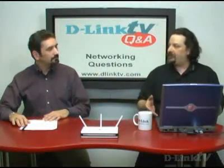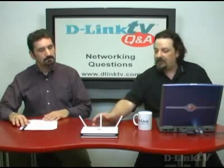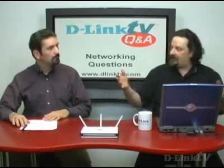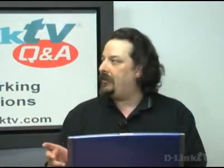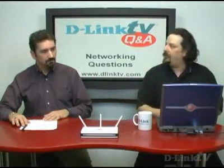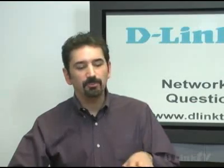Robert in Martinsburg, West Virginia wants to know if D-Link has a product that would allow three computers to be hardwired to one printer — he has three hardwired computers and one printer in a job shack at a construction site. All you'd need is a wired router to make it easy for the computers to talk to one another, and then a print server. Depending on whether your printer is USB or parallel, just get a matching D-Link print server. Plug that into the router and you're completely hardwired between the three computers and the printer. This printer adapter will convert your printer to a network-shared printer.